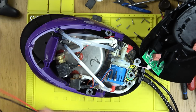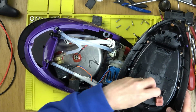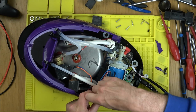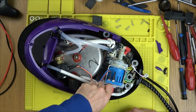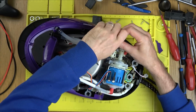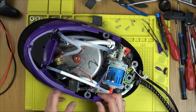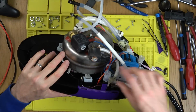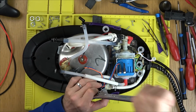So looking at the inside of this iron, there was actually a fair bit of rust, not just on the part that I'm going to take, but also where the cables come into the iron. I can see that the little clamps they use, the screws are all rusty, so there's evidence of rust everywhere. So I think under high pressure, water has been spurting out of this boiler. And interestingly, where the valves go into the boiler, there's that red kind of gunk around it to seal it. Maybe that's a better way than using PTFE tape. Maybe it works at higher temperatures and higher pressure.